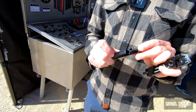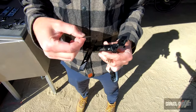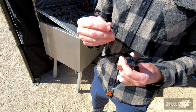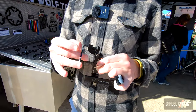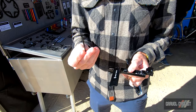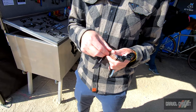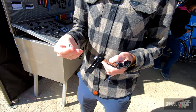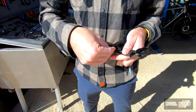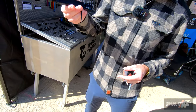On the other end is your chain breaker, which does have a swivel head. Inside the tool there is an L-key — on the short end is a 3mm Allen, and that is what drives your chain breaker. On the other end of the L-key is a forked end, which is your tire plug insert. Included with the purchase is one sheet of five tire plugs. You take a tire plug, put it on the forked end, and it fits right inside the slot of the tool, giving you grip when you do your tire plug.